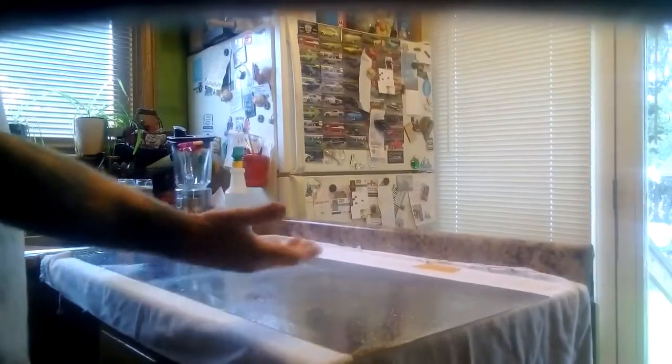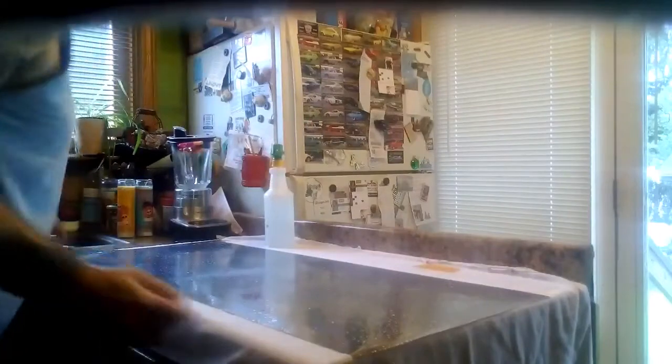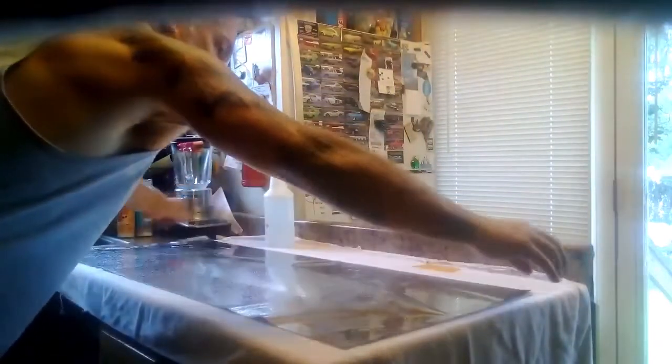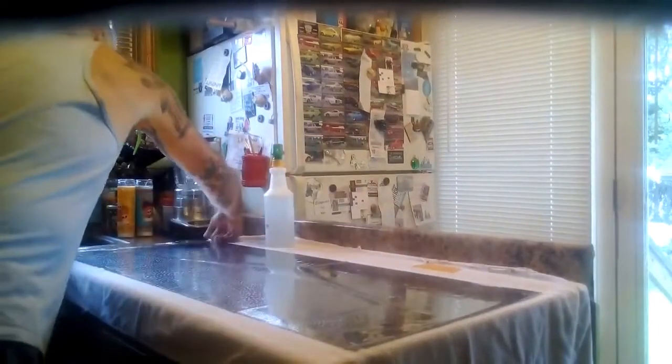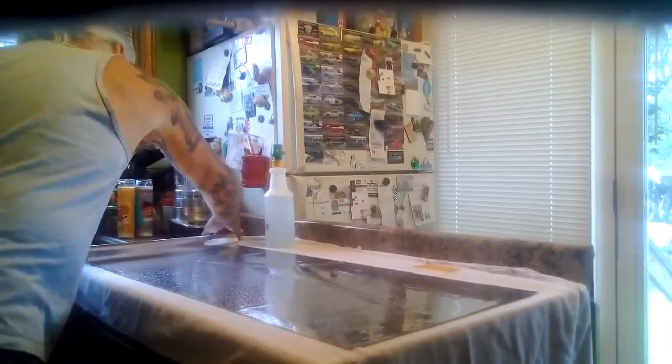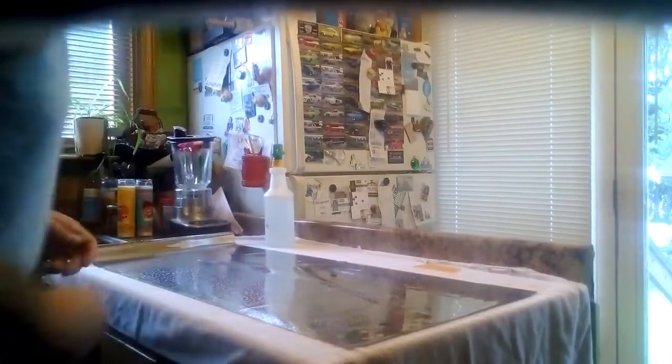So now that you got this mirrored side of the window tint really good and wet, you can flat pick it up, slap it down on the wet glass. Okay. Now, so I'm not losing you. Right now, the tinted side is facing up, mirror side is down on the glass. That's what's going to give you your best result as far as having a flawless mirror when you go to look through it on the other side. Hopefully. See how this is all going.